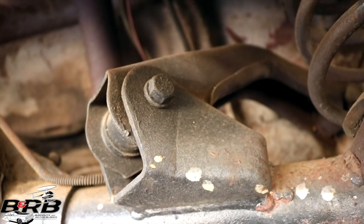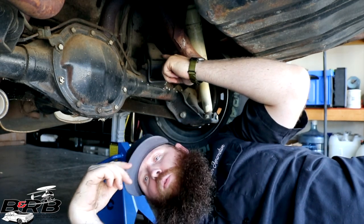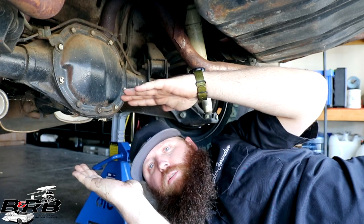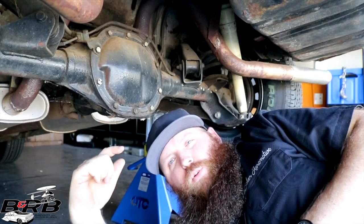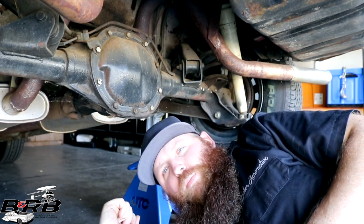We're going to add about 2 inches to that upper mount so that this bolt point is 2 inches higher, so that our axle will not grip so hard, and then it'll do a burnout. If you look down in the description below, I'll put a link to the exact thread that has those pages on HBody.net. Let's get to it.